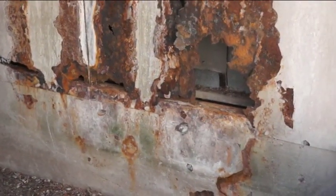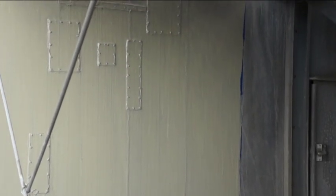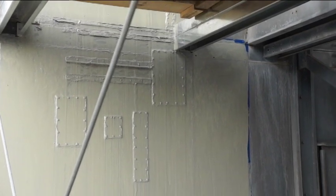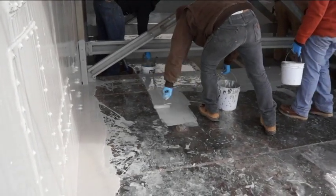Texas Air Systems has covered the more severely rusted areas with sheet metal and then secured them with a coating of Pan-Seal. Here you can see where the sheet metal has been covered with Pan-Seal. You can apply Pan-Seal in any weather, including rain or very cold temperatures — it'll eventually heat up. You can see that it's as easy as just painting it on.